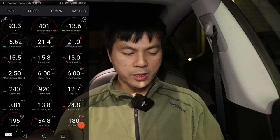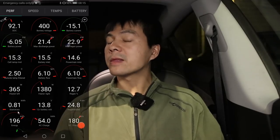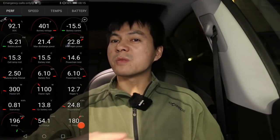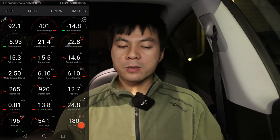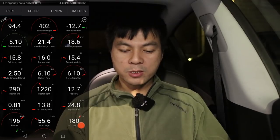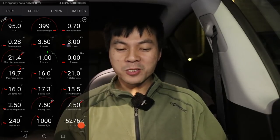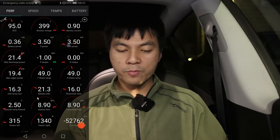It will prioritize charging up. We start with 15 degrees in the battery. During the charging session, the battery also heats up a little — there might be some heat escaping from the cabin down below, and the charging process itself generates a little heat. Then something interesting happens at 95%: once the desired charge level is reached, it fires up the afterburners. The car figures out it's done charging, has more power available from the plug, and now heats the battery.